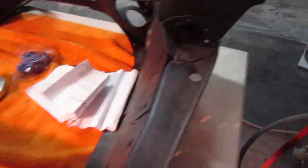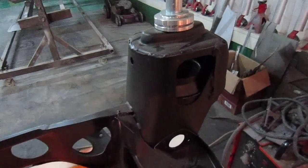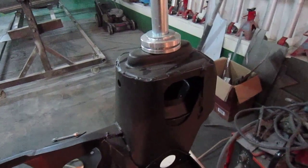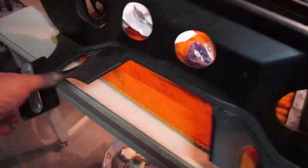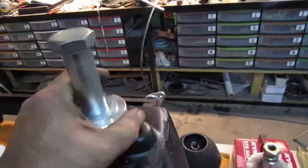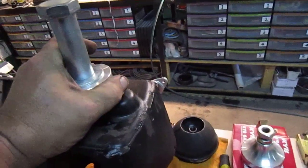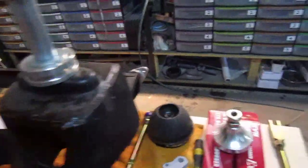You can see they're the solid ones. It will just make the steering much more direct and precise because there's no movement between this and the subframe — and the steering is mounted to the subframe.